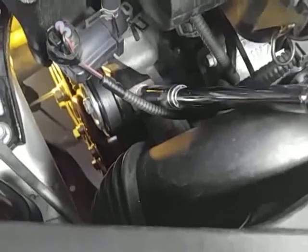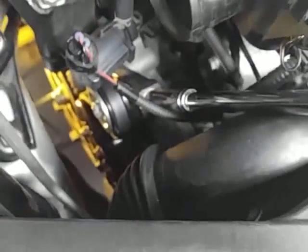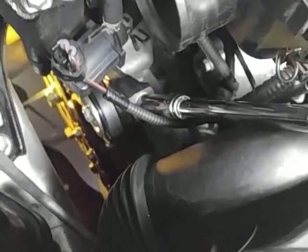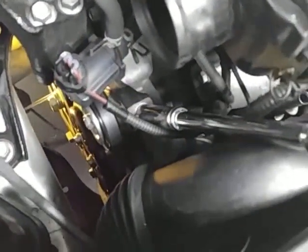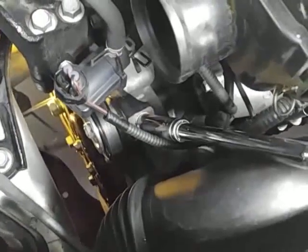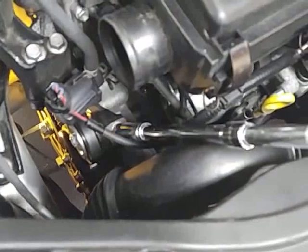I would just leave that pulley on, because if you take it off, it all comes apart and you got to figure out which way it goes because it's got a bearing in it. Just leave it on there and loosen it real loose, because it helps putting your belt on if it's on there. If you can, torque it to 30. If you can't, just tighten it as tight as you can, and then adjust the tension out. It says 8/10 of an inch, but just feel of it and get it as tight as a rubber band. Just get it tight so that when you press on it, it just barely moves down. And of course, recheck it after you've run it a while.